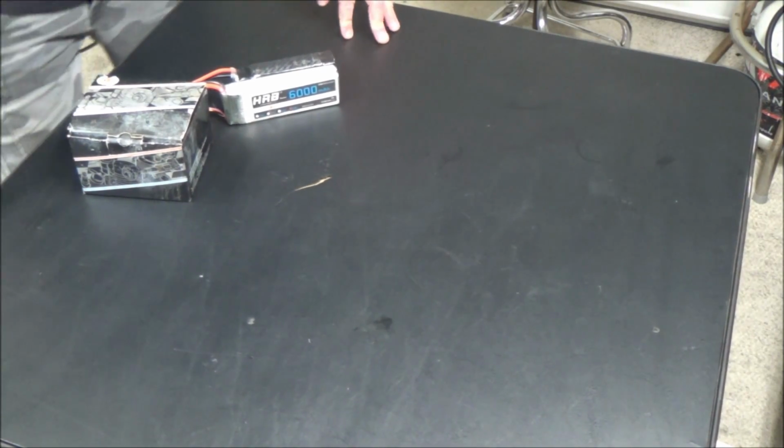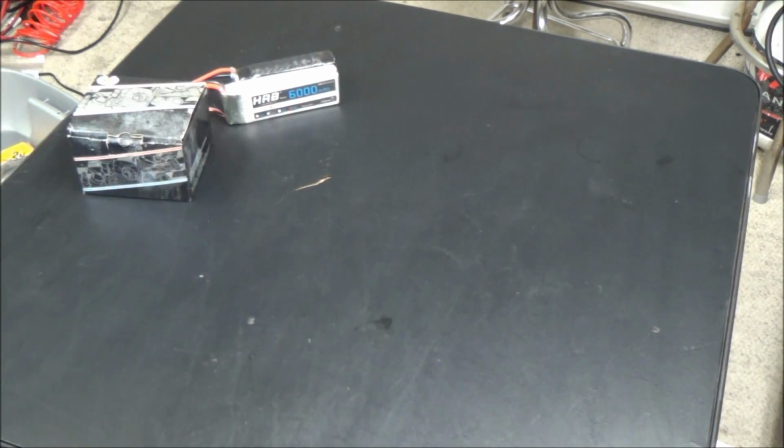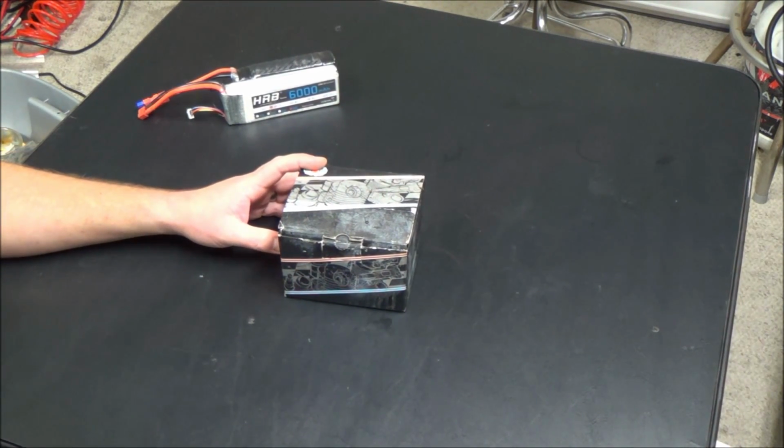But remember, guys, it does separate. So if you have it sitting for a long time, it almost becomes useless. So don't bulk buy nitro. To me, it's not worth it unless you're really running it hardcore all the time, and you're going to go through a gallon in like a week. That'd be worth it. If you're going to run your vehicle every couple of weeks and then let it sit for a month or two, then that gallon's going to last you forever.